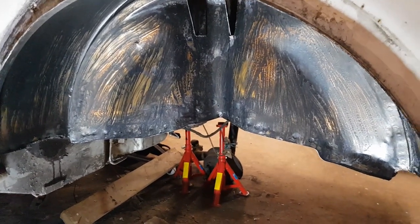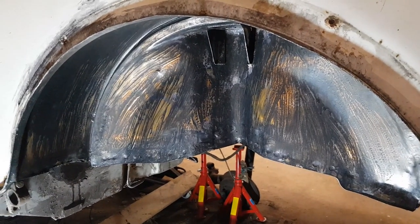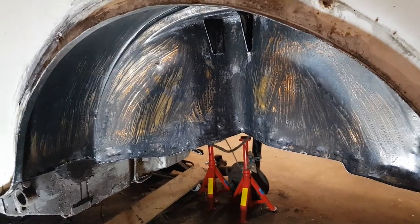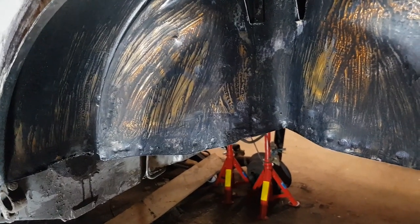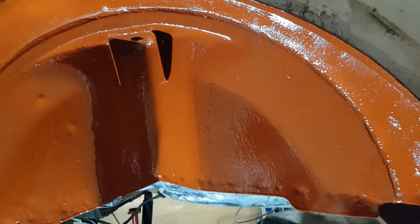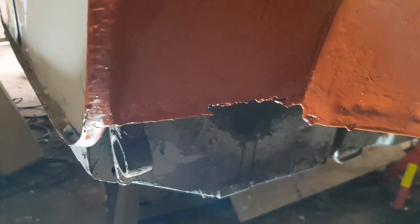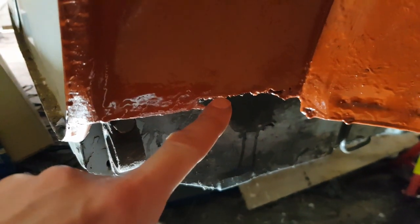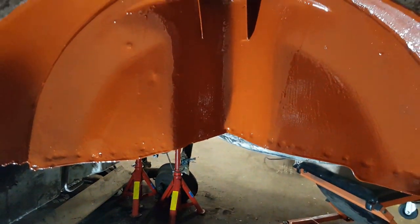I've decided to get this painted now. I'll do this and the floor separately and keep this as a short video — YouTube analytics suggests short videos perform better, and from what I can tell you guys like the shorter videos. Comment below if you prefer longer or shorter videos — I tend to keep them around 10–15 minutes. I'm going to paint this with the Bonda rust primer. That's all painted up and protected now. I've got a little frilly bit down there that I'm actually going to sort out when I do the floor in the next video — there's a little hole behind it in the companion box so I'll sort that out then. Good day's work.